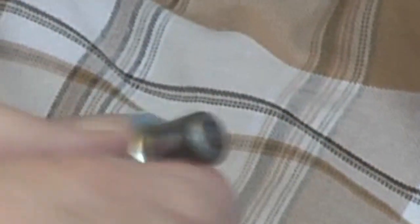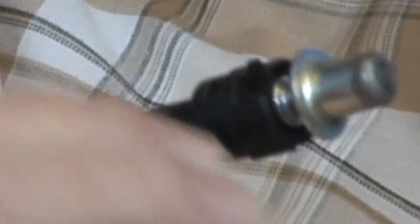I got it out. You don't have to take this whole line off if you want to just pull it out — there's a little release right here on the side. You see there's a little tab that you push down and pull it out. That's how you release your PCV valve. Once you get it out you can drill it out. I should have done this mod months ago, maybe a couple years ago. It should have been one of my first videos, but this is very important to do.